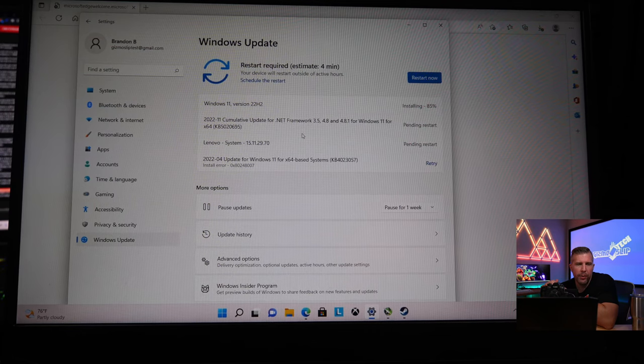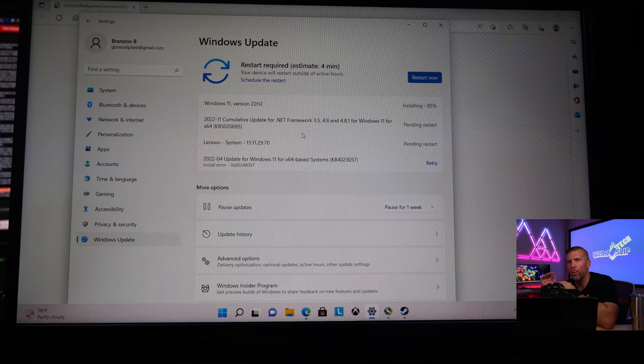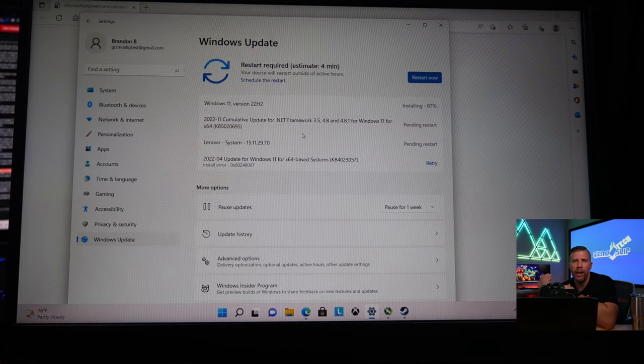And the last thing you might be able to do is you could throttle it yourself, depending on which power mode you're in. I noticed that if you're in a low noise power mode, like the quiet mode, sometimes those have the highest temperatures on the laptop because they're trying to run the fans at a really low decibel level and they're just not moving enough air to keep the temperature down.